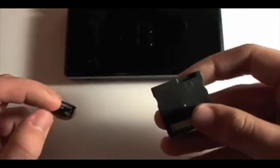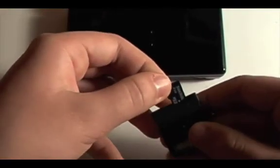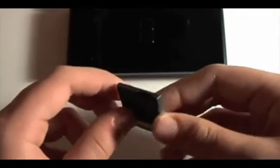Now that you've got the correct files on your USB micro SD reader, just take out the micro SD card and put the USB reader aside. Then take your R4 — if you look on the back there should be a little diagram of how to plug the micro SD in. You should have the text on the micro SD facing you with the R4 facing away, and then just push it in. You won't really feel a click, but just make sure it's level along here.